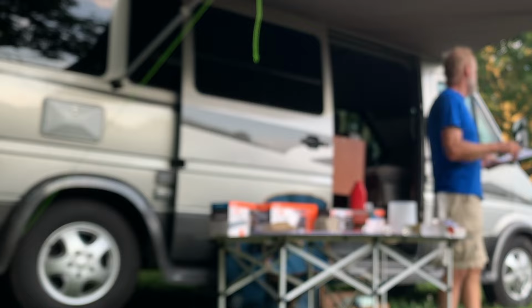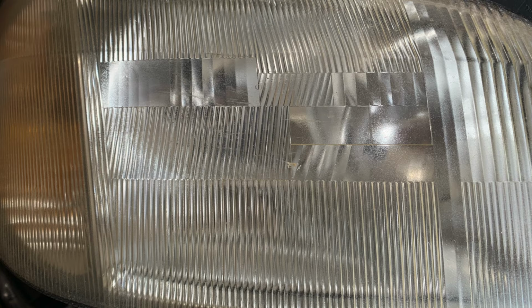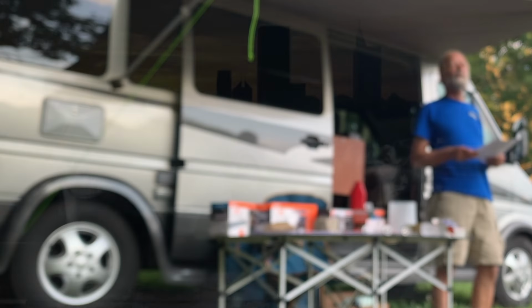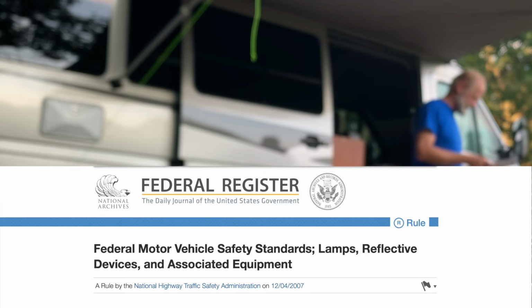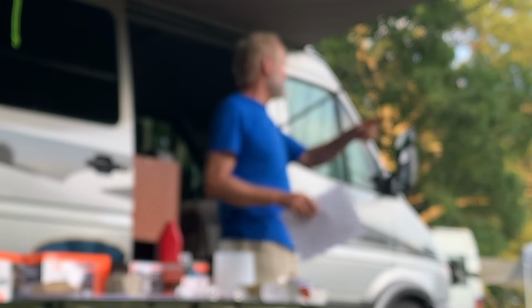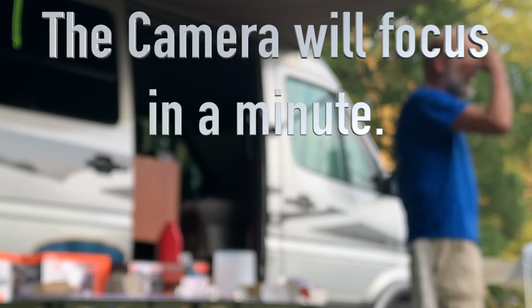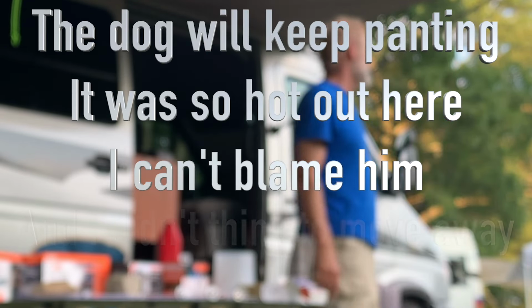Optics refers to how the emitter and the light source and the assembly combine to give you the best light on the road. And the emission pattern in this country must meet federal requirements, FMVSS 108, and light systems must be properly matched to get a desired result. Any of you who wear glasses, if you put them in front of your eyes, on your nose, and torque them, you're not going to see.